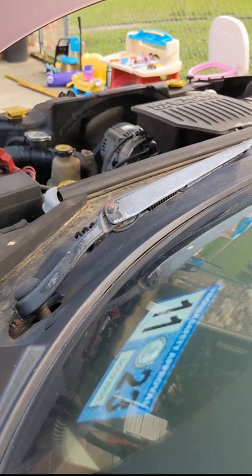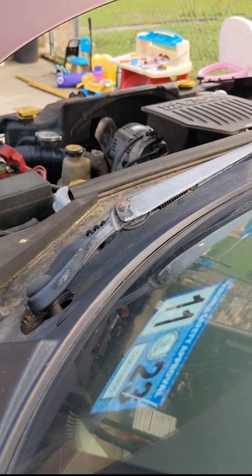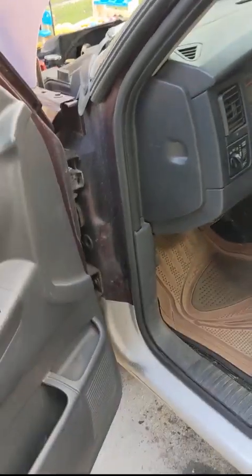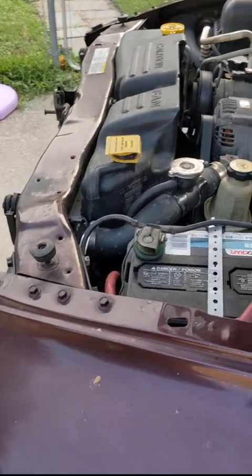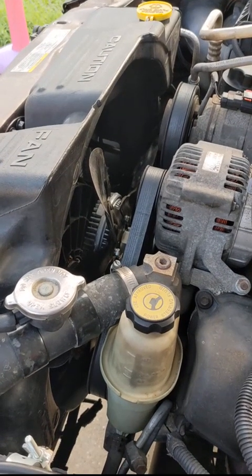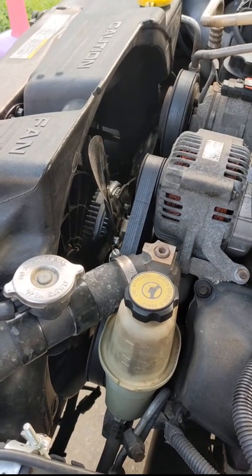It kind of starts to slip a little bit there, but watch when I stop. It rotates a little bit afterwards. The other one would come to a dead stop the minute it stopped, which in a way is good, except that the engine's cold. It should kind of slip while it's cold. And then later, OEM ones are a little different than aftermarket, but aftermarket, I guess when it gets up to temperature, that's when it'll kind of start to lock in at a specific temperature, and then it'll drop down some.